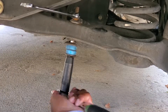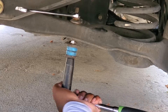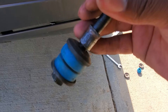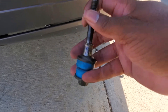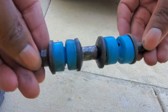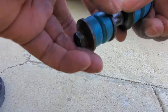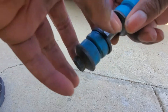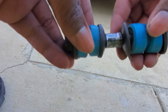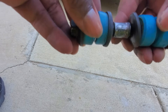You want to spin this so it gets locked into place where it can't move, and then you can get it off — it's kind of bolted like that. This is the broken part. I think this piece was sliding on the sway bar link or on the sway bar itself, causing it to creak. When I originally replaced both sway bar links, I did it wrong — I had these two pieces squished together below the bar, and two pieces squished together above the bar. This piece, which is damaged, was getting rubbed on by the sway bar and it basically snapped — not the whole link, but the little roller piece in the middle snapped.